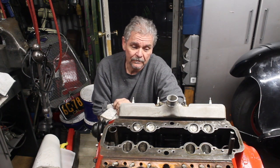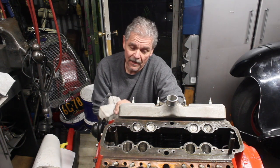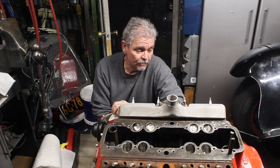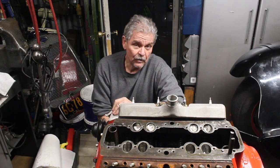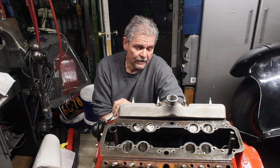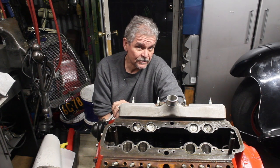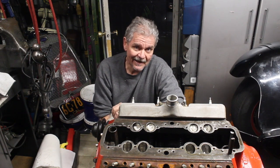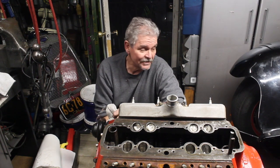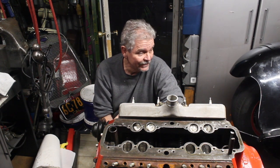The oil pump seized or stopped working, or something happened to the oil pump, and it was binding up really, really bad, and I didn't have any oil pressure when it was idling for a while, and I think that started the problem in the rods. And over the past 2.5 years that I've been driving it, I think it's gradually gotten worse. But like I say, I can't find a darn thing in the oil. I tear apart that oil filter every time I change the oil. I change the oil religiously.